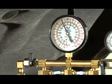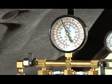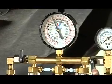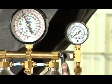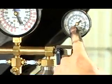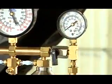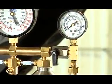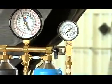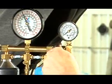You will want to be looking for any leaks throughout the apparatus. As long as there are no leaks, the next step in the process is to slowly open the ball valve on the fuel rail side until the gauge reads the appropriate PSI that the fuel pump in the vehicle normally puts out. You will know this by looking at your manual to find out the correct PSI. So slowly turn that ball valve.